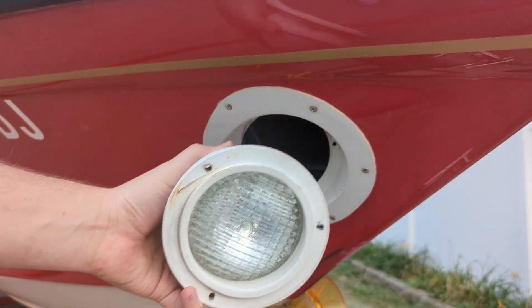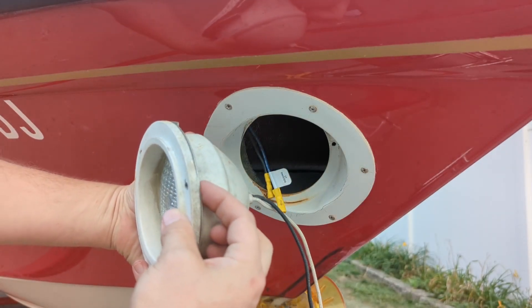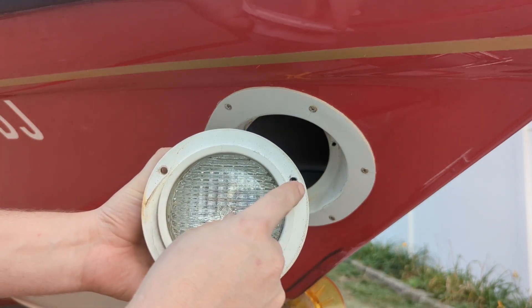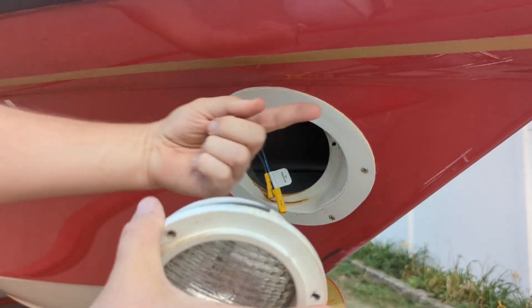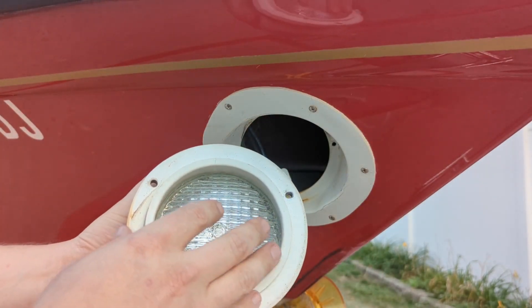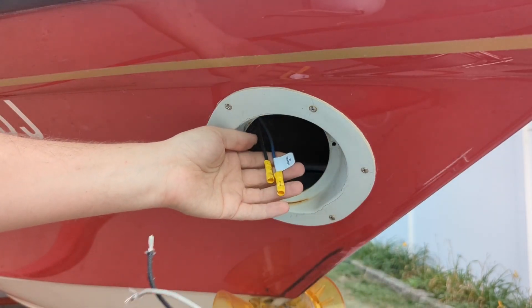Okay, so here's the light removed. Basically there's a bolt that goes through and there's a nut on the back side and another trim ring. What you've got to do is run the bolts loose on the face and then get in behind there — pull your front seat out and grab in behind there and hold the nut, otherwise they'll just spin forever. So I got this out. Here's the wires — I ended up just pulling the wires and those crimps gave up real easy.